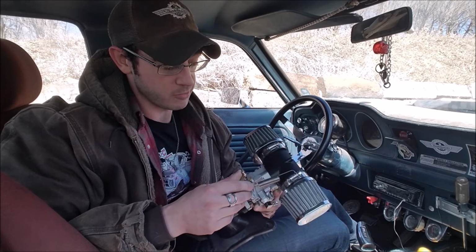Now this thing, I guarantee it's going to be making vacuum at like wide open throttle. You know, it's just not going to volumetrically fill the cylinders that well. So it won't necessarily be a lean mixture, but it'll be a less dense cylinder charge that's going to ask for a lot of ignition timing in order to burn that cylinder charge at the right time in the stroke for it to be able to run.